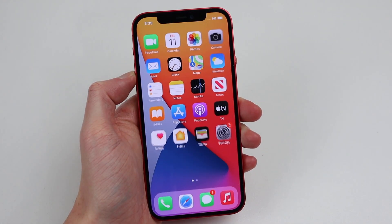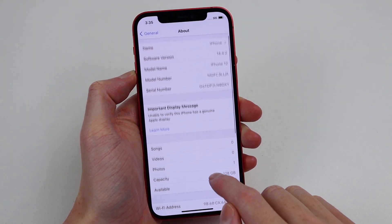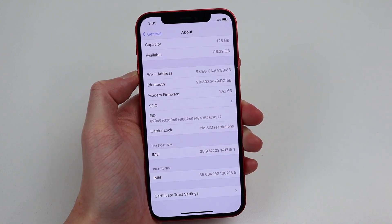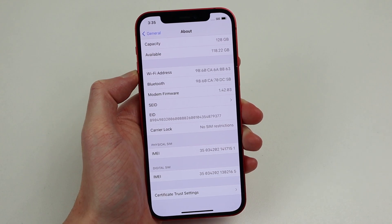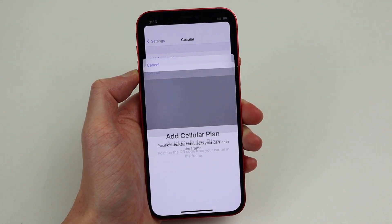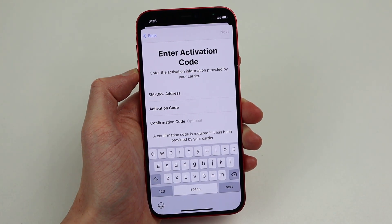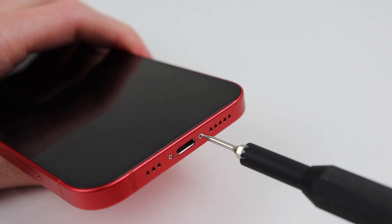For this experiment, I'll be using this iPhone 12 I repaired a few weeks ago. It's fully functional and is a single physical SIM model with an additional digital SIM. While you can run two phone numbers, if your carrier doesn't support digital SIM or you already have two physical SIM cards, this configuration doesn't work. As the SIM tray is modular and the phone already has two IMEI numbers, I'm hoping this upgrade will just overwrite the digital SIM and use its IMEI number.